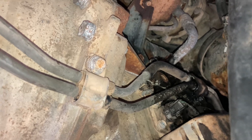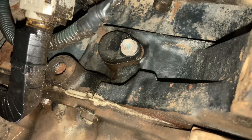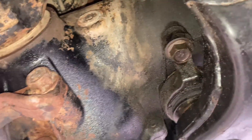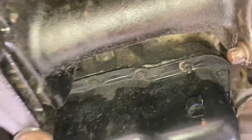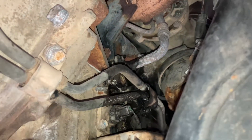Around the bolts you can see the excess RTV there — you wouldn't see that from Toyota. Coming down that wiring loom off the starter, it's just a real mess. Looking at that RTV on the sump, as much as it doesn't look too bad, it's the exact same colour as the other stuff. So I don't think that's a Toyota job — I'm pretty confident it's not. Looking up at the sump, you can see the excess under the bolts. It does look a bit not-Toyota; they have used the right colour but it's a little lighter and looks a bit different. There are a few bits that give away the evidence — it does look like the sump's been off, but it's a bit difficult to tell.